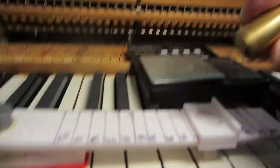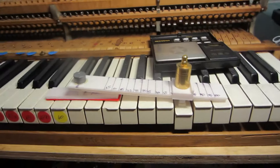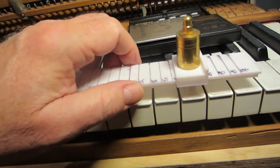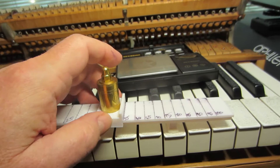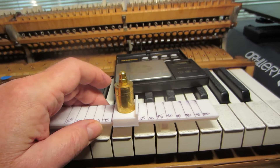This was based on a device that I saw in a video, but I changed the design to make it work better for me. We can see that 85 is too heavy for this key. At 50 it's good. 55, 60 — it's supposed to be 50 and this is barely moving at 60. 65 even has resistance. 70 grams will make it move.